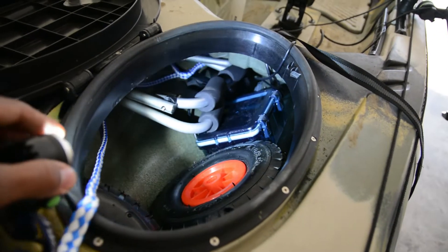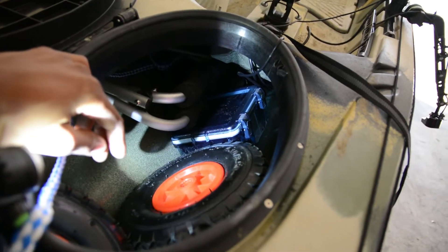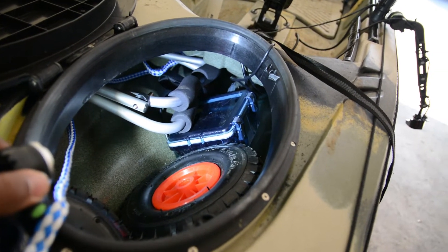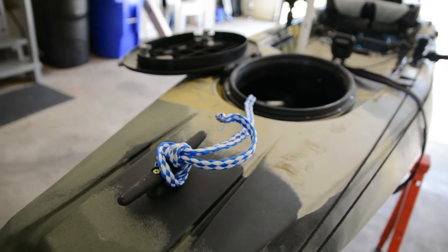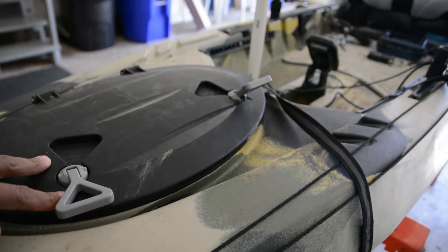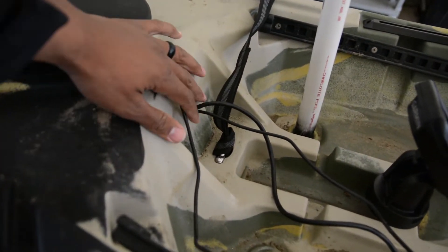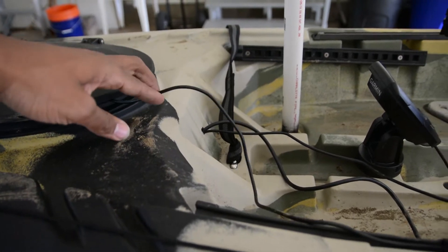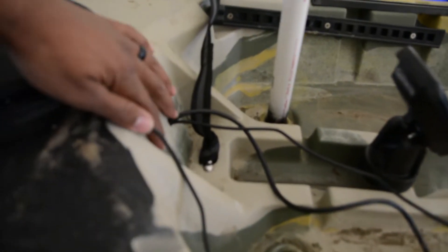Down here in the hatch I got my wheels ready for transport. I can take those out and take them with me anywhere I go. I have a battery box in here for my fish finder — that's waterproof and it's velcroed down so it doesn't slide around and move. I put this on just to have something to tie off to if I were at a dock or something like that. It seals very tight, a good seal all the way around. I have my wires coming out right here through a small hole — I'm going to end up putting some marine glue right here. This right here is just the cord going out to my transducer; I'm probably going to end up bringing that cord through this middle section right here.